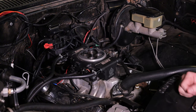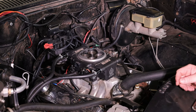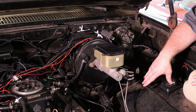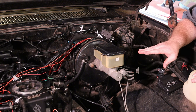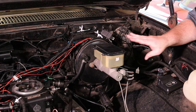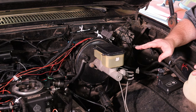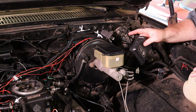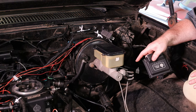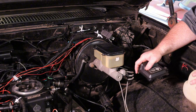We need to start running the wiring harness now. We'll go over the connections and how I've got that set up. We're what — four wires and two connections away. We're going to mount our ECU here on the fender on this vehicle. For a super clean install — which we will be doing another install on this — we're going to be putting it inside of the vehicle, which is much more preferred. That way we have a minimum amount of wiring outside into the engine bay, and all the business, relays, fuses, and connections will be inside. Moving it inside will also help protect the ECU against the environment, even though it's very well sealed in cast aluminum and is a great heat sink.